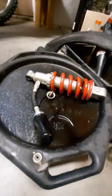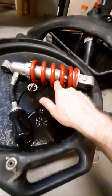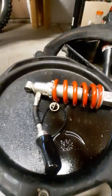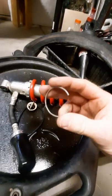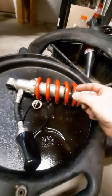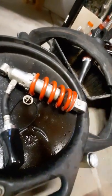This is just the first step. To do this properly I'd like to use a spring compressor to remove the spring, then get in here at this cap on the body - I'm guessing it comes out similar to KYB or Showa designs - though this is completely different equipment. There's probably another circlip inside the shock body retaining the seal head. To access the valving you remove that cap, take the circlip out, the seal head comes out, and then the piston with all the valving comes out behind it.